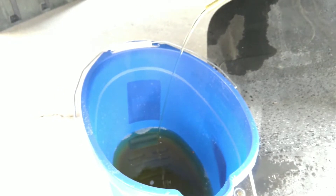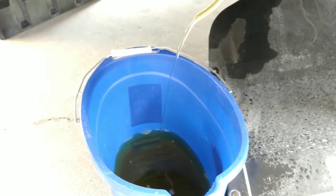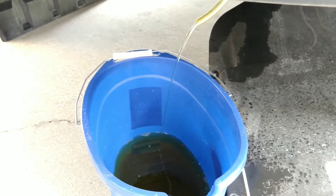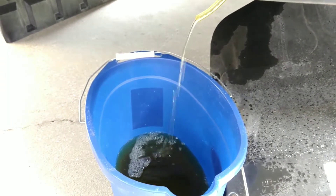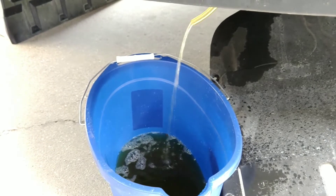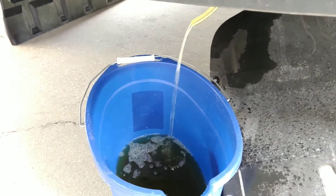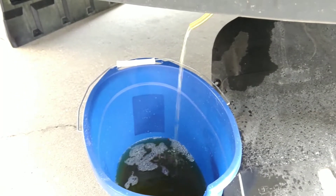I'm going to figure out how much coolant actually comes out and then try to fill back that same quantity. My plan is to fill it up with distilled water once the coolant flushes out, turn on the vehicle, put the heater on high, let it run for five to ten minutes, and then flush it out again and repeat the process a few times.